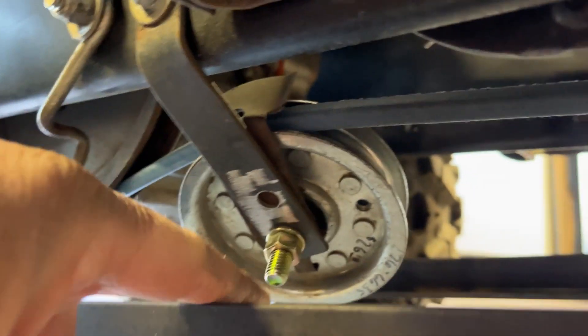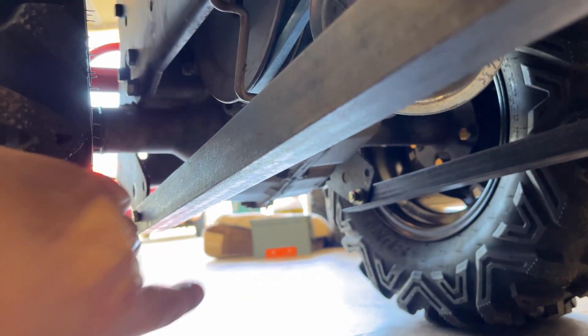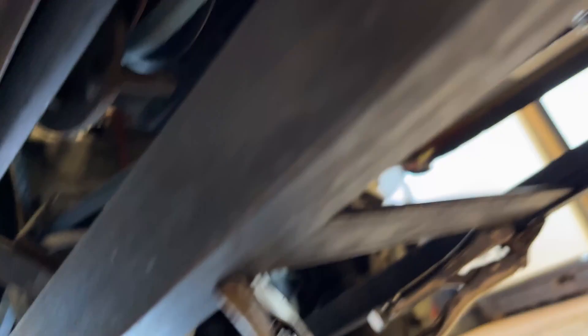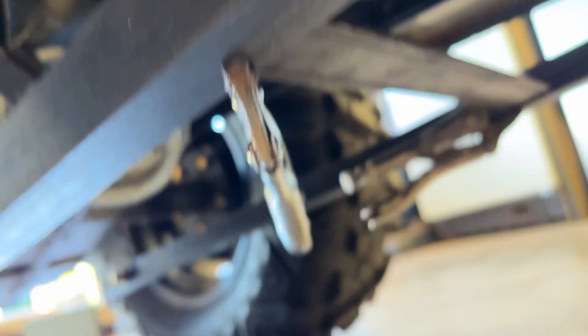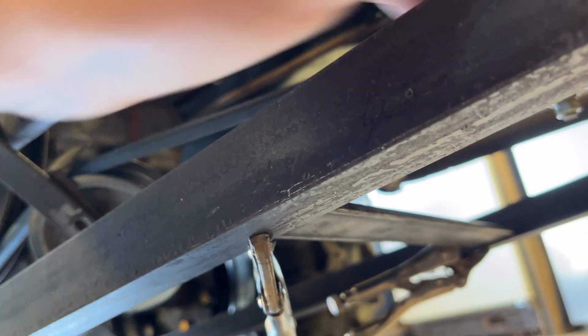As you can see, I've got plenty of room to protect this pulley, and I do plan on skinning from about right here, about an inch up, so I don't want to get into the steering — and maybe all the way back to protect the transaxle and this pulley, and I guess the steering too. So we'll get to it. I need to take this back off and weld this cross brace.